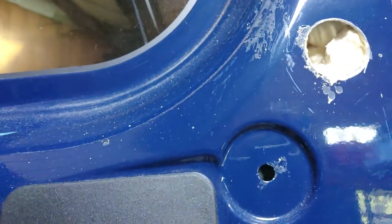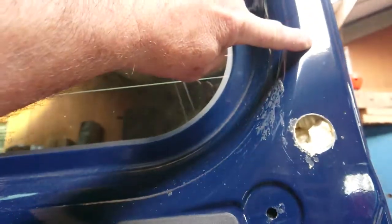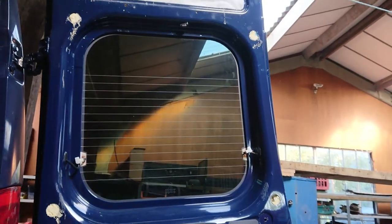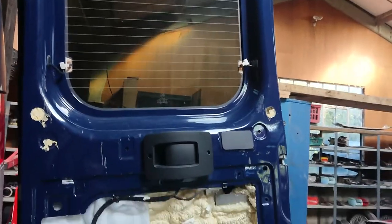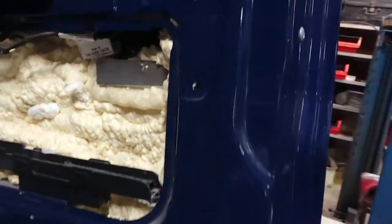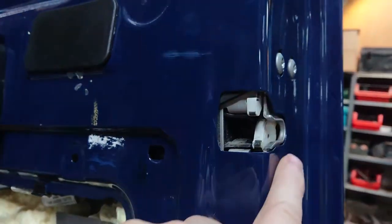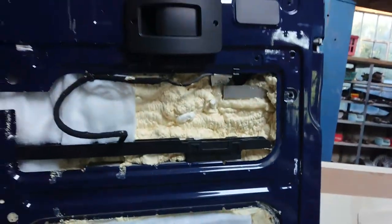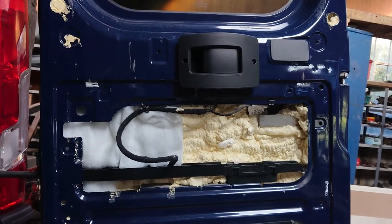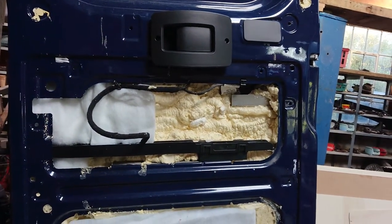I've gone up all of the cavities that I can — as far up as possible, it's not going to be perfect and I don't expect it to be. A vapour barrier can't cover all these holes anyway — there are lots of places you just can't protect completely, all the locks. So I believe there's enough air movement to allow any moisture to evaporate.